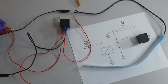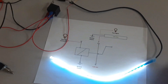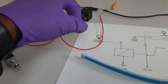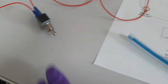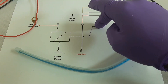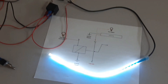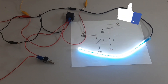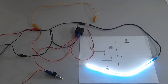If you follow the wiring diagram, everything will work perfectly and you can connect it to any car. You can also use the relay for other functions — for example, connecting a fog light to pin 87 so that when you turn on your headlight at night, the fog light also comes on. I hope you find this video helpful. If you like it, give it a thumbs up, kindly subscribe to my channel, and thank you so much — see you again sometime, bye.